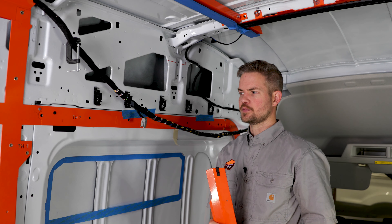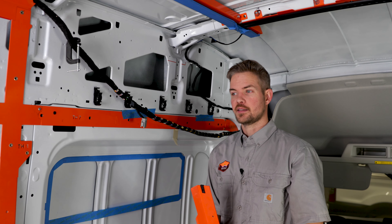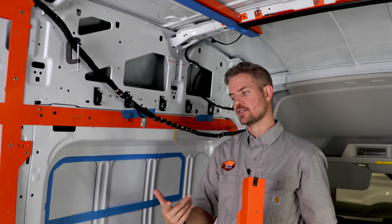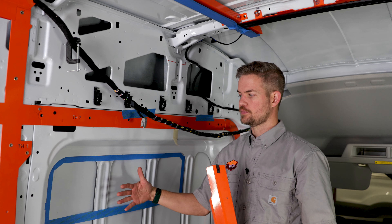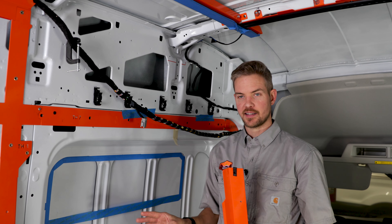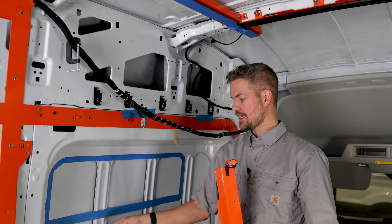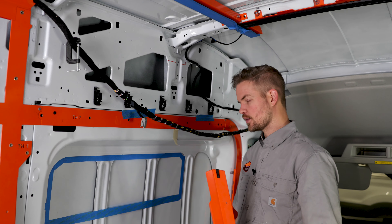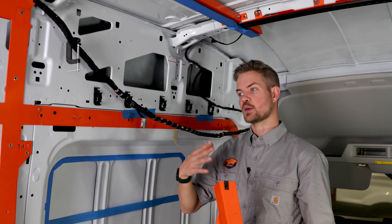Those are raw steel filings, so they will rust over time with moisture coming through the wall. With vans you have to control moisture — always ventilate with the roof vent since it's a sealed environment and your breathing adds humidity. We prevent rust by applying rust preventative over every surface that's not painted, or surfaces that have been drilled or riveted. Do all window cutting first, clean everything out, vacuum and wipe, then put in the hush mat and insulation.